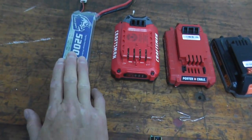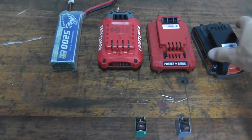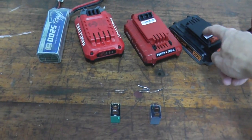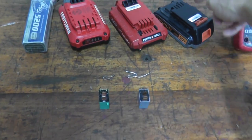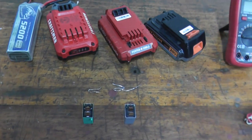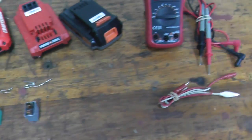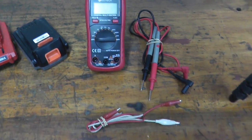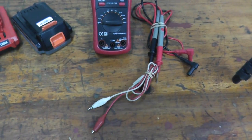This is an RC car battery pack — if you're into RC cars, this is perfect, as it pushes out 12 volts. You may also use a cordless tool battery pack, but be careful because many of those push out 20 volts, which can blow the relay. This one is exhausted and pushing out roughly 14 volts, so I'll use this one. We also need a paper clip cut in half, a digital multimeter — inexpensive, around $20 on Amazon, with links in the description — and two wires with alligator ends.